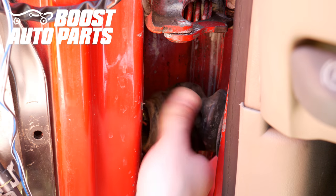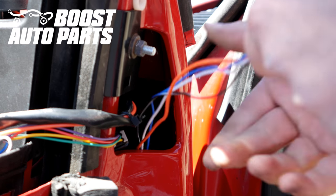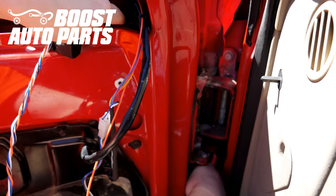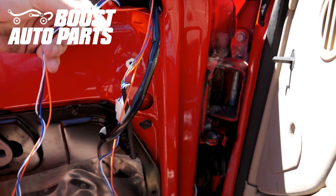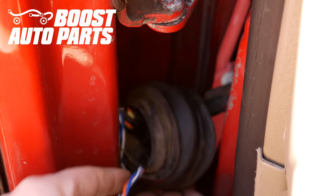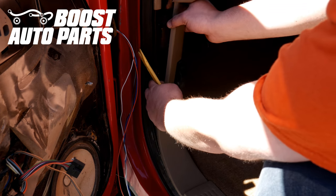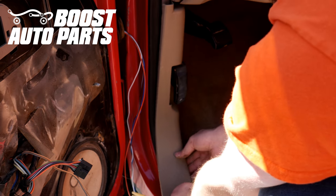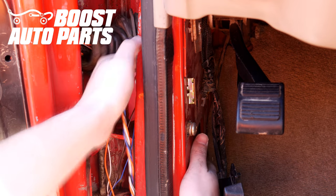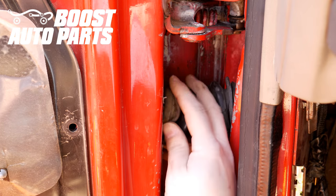Now you're going to go ahead and remove the rubber grommet both on the cab and door side. Now go ahead and just feed the taped wires down into the door, then reach your hand down to the door boot area and try to grab them. Pass all those wires through the door boot. Now using a body trim tool, go ahead and remove the trim piece next to your hood release. Pass the wires through and grab them on the other side, then put your door grommet and boot back in.